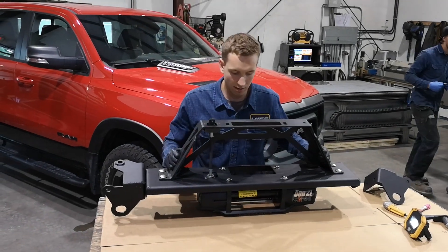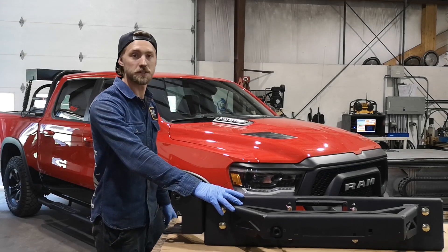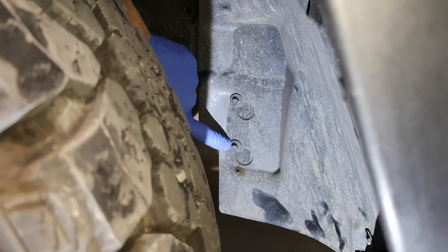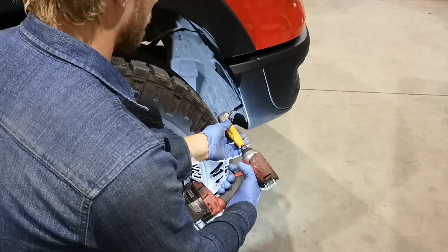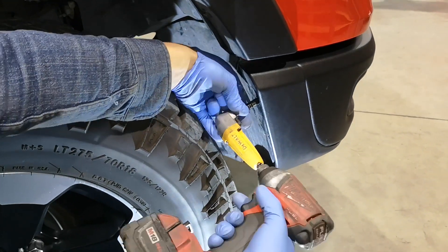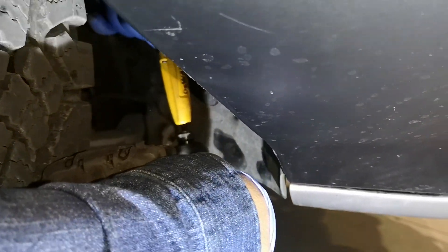If your winch does not come pre-wired, do that now. With the winch mount kit mostly assembled, we'll remove the stock bumper and get it installed. First, remove the lower inner fender — there are five fasteners on either side. Using a right angle tool helps and keeps you from having to take the front tire off. Remove the first three fully and the last two just partially. This lets you grab the inner fender, slide it up over the fasteners, and out of the way.